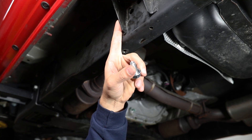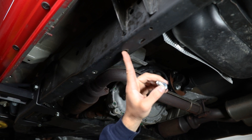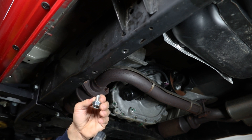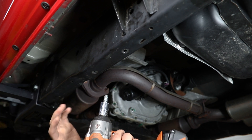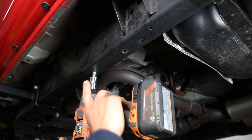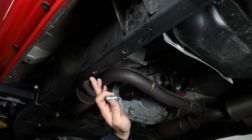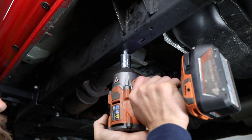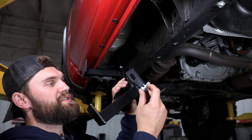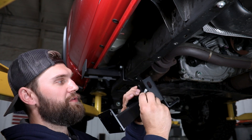Don't forget to use touch-up paint as needed in the body mount hole. In the two bottom holes, we provide half-inch thread-cutting bolts to cut threads into those — then you'll remove these and install conventional hex head hardware along with washers when your mount goes into place. For these you just need a three-quarter-inch socket and ideally an impact. With your 7/16ths hole drilled, apply pressure to the impact and run this in to cut your half-inch thread. Additionally, if you have a tap and die set and a half-13 tap, you could simply tap these out and skip the thread-cutting bolts altogether. With all your holes in place, install this again with a half-inch by one-inch-long bolt through the body mount and half-inch by inch-and-a-half-long hardware in the other three bolt hole locations.